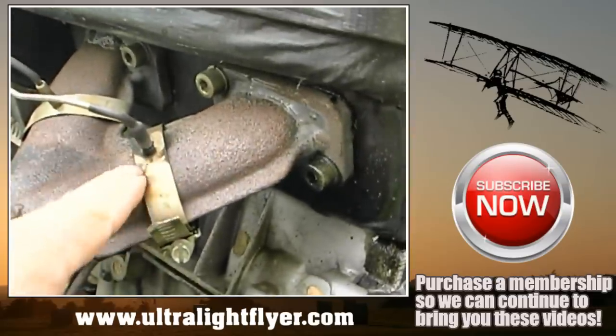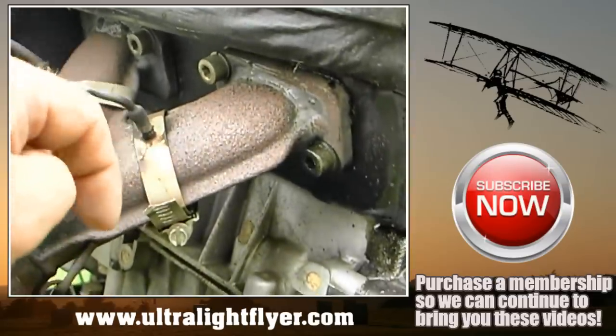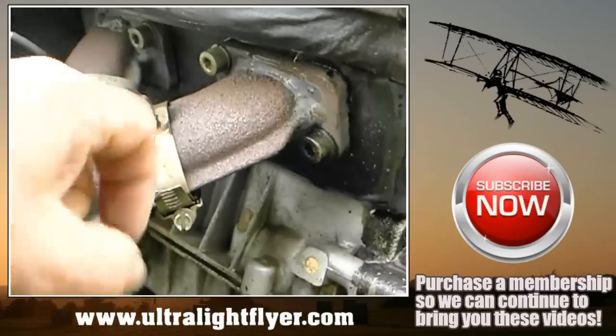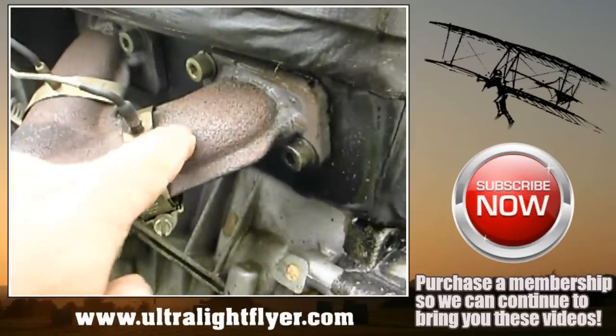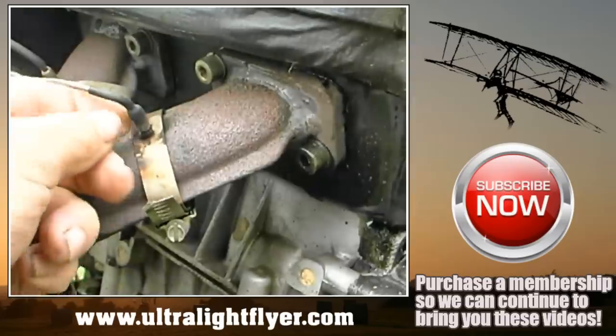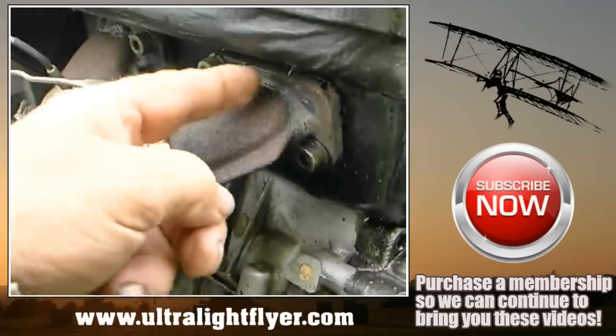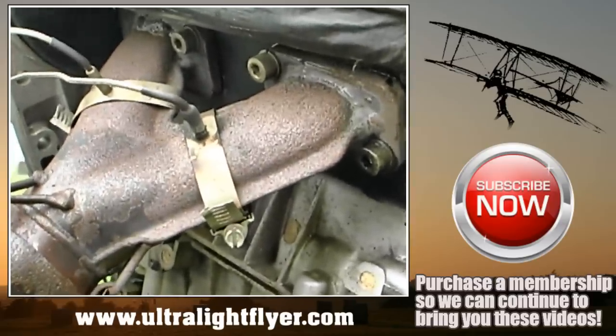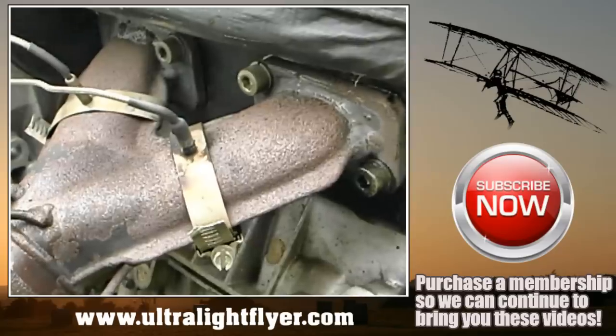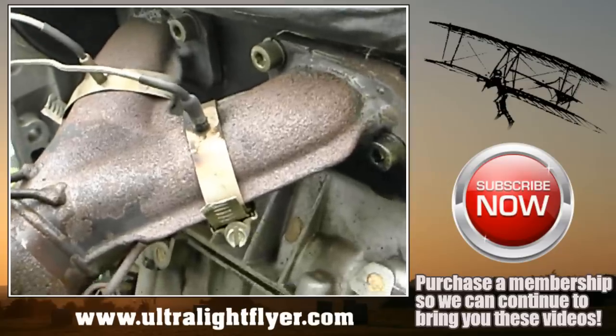This probe location looks wrong. The probe also sticks into the exhaust and cannot touch the bottom of the pipe — you may have to put little spacers underneath it so that it sits in the air in the middle of the pipe. On newer engines, there is already a space provided for the probe and they use a different style of probe.